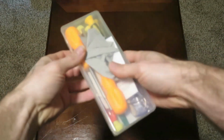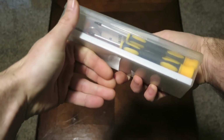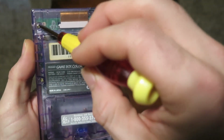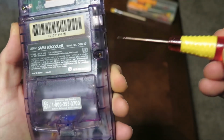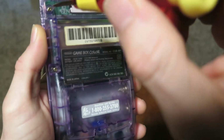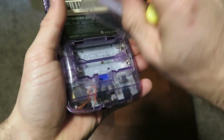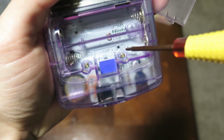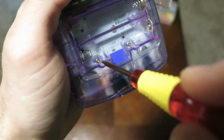The most important tools we need for this project are in this tool case right here, and I will have a link in the description for that. We're going to start off by taking the tri-bit here and taking these 4 screws on the outer shell. We're going to remove those there, as you can see here. And there's also going to be 2 more inside the dust cover, inside the battery cover here. So we're going to take that off. We're going to go ahead and use the same tri-tip screwdriver. We're going to take those 2 boys out. Make 6 screws in total.